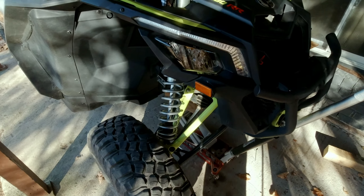Now that the front ride height is set properly, I'll recheck the rear. Transferring weight to the back from bringing the front end up probably dropped it a little — and we are a little over a quarter inch shy. Unlike the front shocks which are a two-to-one ratio, the rears will be one-to-one, so for every inch I compress the springs in the rear it'll bring the ride height up one inch. I'll preload these springs with the collars about a little over a quarter inch and come back and check.